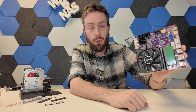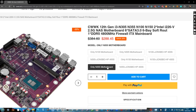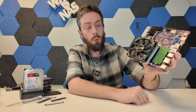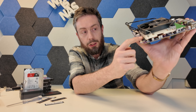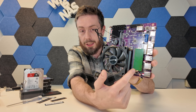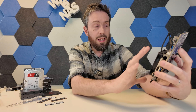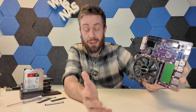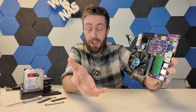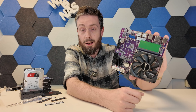Regarding the bundled cooler — I used one from another device rather than the shipped version. No matter how you place it, you end up very close to transistors near the CPU, or slightly overhanging the SO-DIMM DDR5 memory slot. The placement is just awkward. My recommendation: don't buy the cooler they bundle with this. Buy your own thermal paste and aftermarket cooler, because the bundled one is just too big.